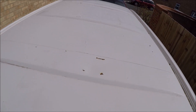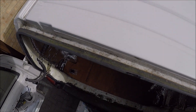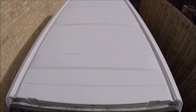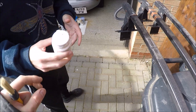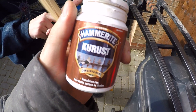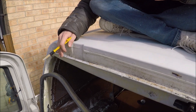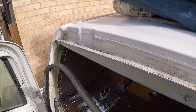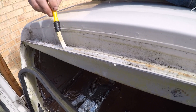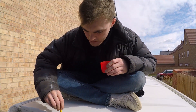I'm up on the roof of the van and I've noticed a few patches of rust. So what I'm going to do is get some rust treatment and some white Hammerite and go over that before anything's mounted on the roof. I've just pulled back the rear door seal — that just pulls off — and I'm going through and putting a bit of rust treatment on this edge because it's starting to go a little bit rusty.